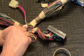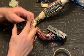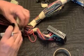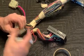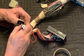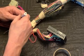The 3 in the C100 connector go straight to the Tach Module connector, so it's easy to find them and figure out which ones you're going to be using. Like I said, I'll be putting up a bunch of paperwork on my website, and then I'll make some links to all of that, and try to add some cards and stuff as I'm able to bring information forward. A lot of this information is just found all over the internet, and I've just collected it for a long time.